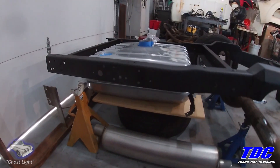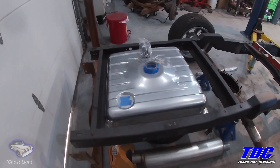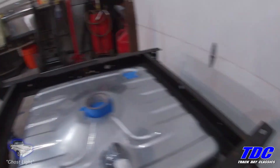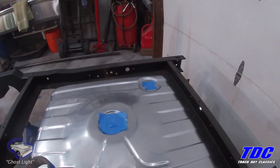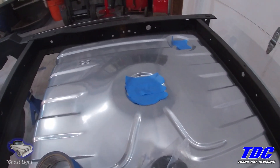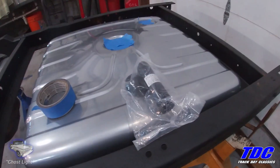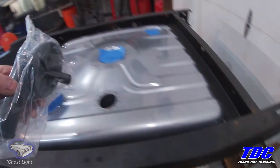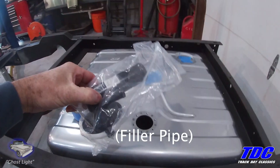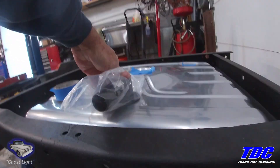...was that this was the best fit and I could get the largest amount of gasoline in. There are some considerations — it does hang down a little bit, but I think it's going to meet the needs of what I'm looking at. One of my main considerations was that it was a fuel-injected tank. So I got this tank from Tanks Incorporated. It has a sending unit spot in the back and also a spot for the integrated fuel pump and pickup.